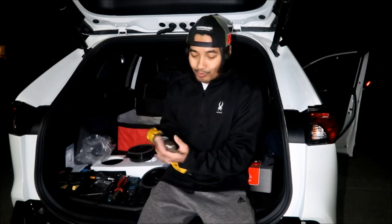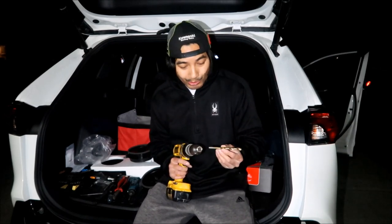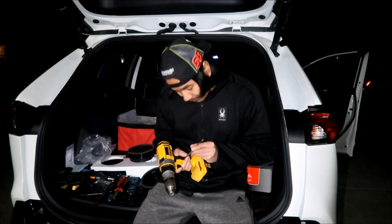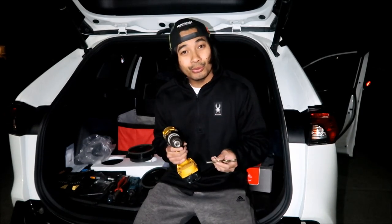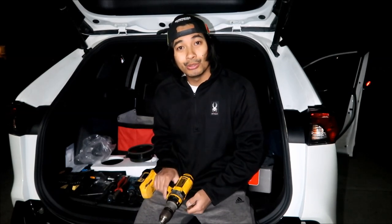Okay, and then for the drill bits, I will put all the tools that I use in the description of the video. But for the drill bit, I use an 11-32 to drill the hole for the wiring. All right, and I use a 1/4 inch to drill out the rivets.